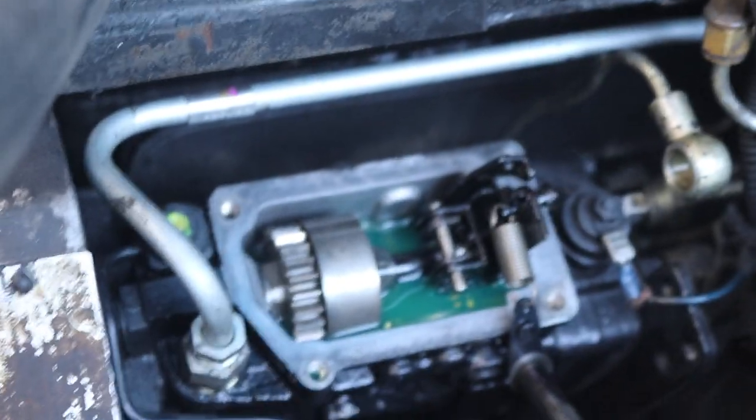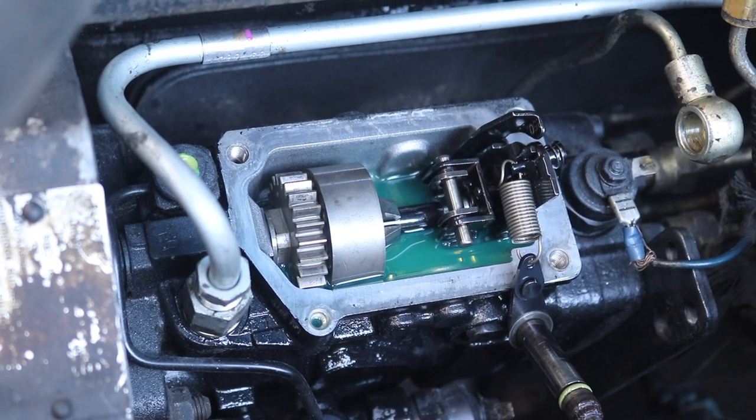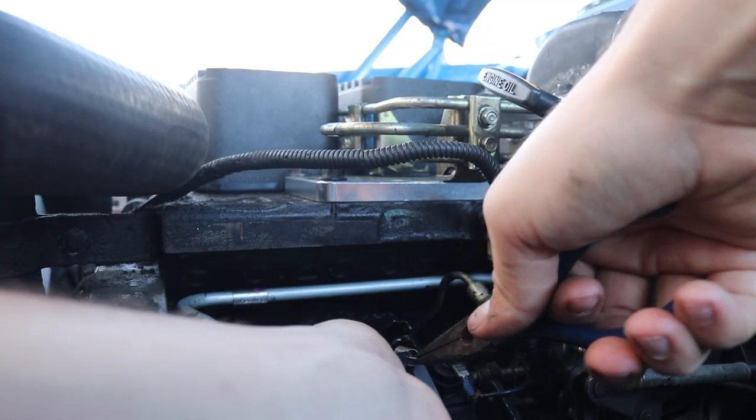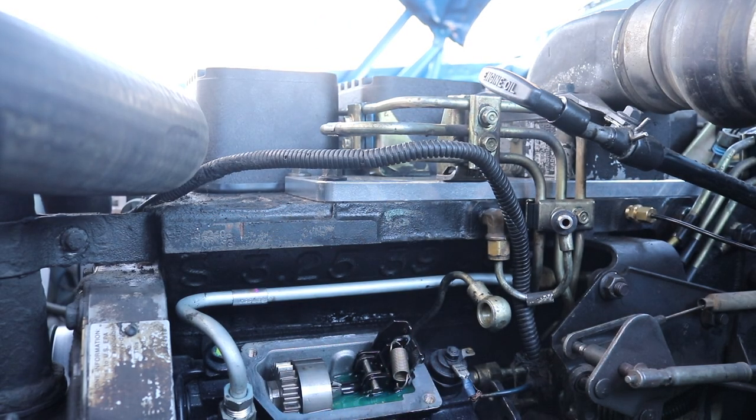Here's what it looks like underneath. I'm going to need a set of needle-nose pliers and my other spring for the next step. It should just pop off pretty easy — and that's off right there. It's easiest if you have your 3200 governor spring in hand ready, pop the old one off, and swap it out real quick.